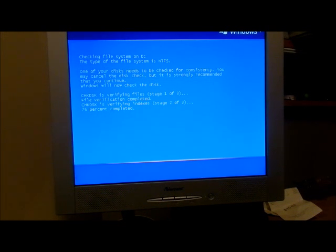Now, I've never used the Seagate for Windows tools, so that would be something new to all of us. Seagate is a good company. Western Digital and Seagate used to have tools on floppy disk that would, when a boot sector was bad, let you pop the tool in there and reassign sector 1 as the 0 sector, as the boot sector, and the hard drive would be up and running again. So, couldn't find that. Don't know if that would have helped out at all.